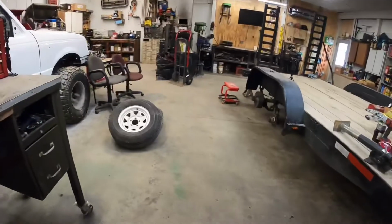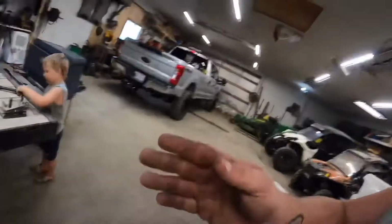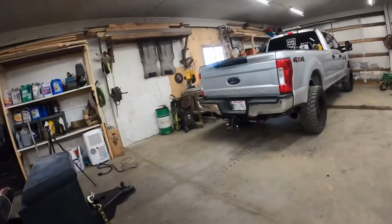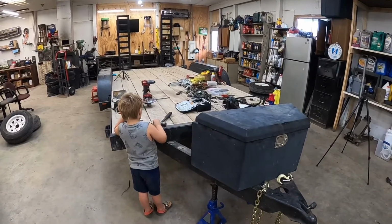So back to those spare tires, but I got a whole slew of them over there. Back to tires. I just don't see a good place that would be extremely easy access, like the side or the front, to get this tire. So what I'm gonna do is I'm gonna steal the automotive techniques. I am going to get a cable system. I'm going to weld it right underneath the middle of it, and we'll keep our spare tire under the trailer. You won't see it, so then, you know, less likely it would ever maybe get stolen or anything. I'm going to put a piece of metal under there, connect the I-beams, weld that piece to it, done deal. And then just unscrew it and everything.